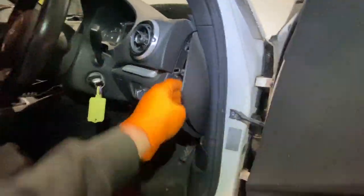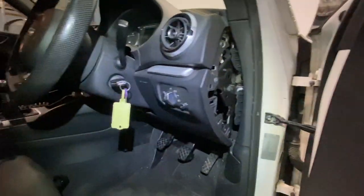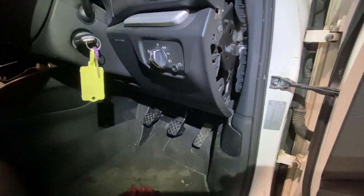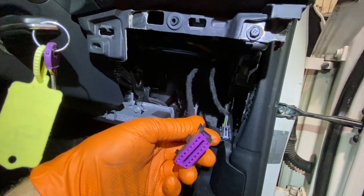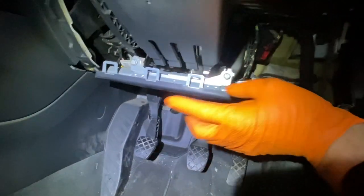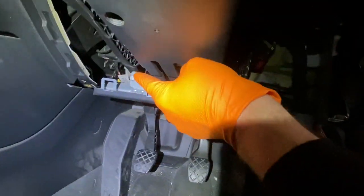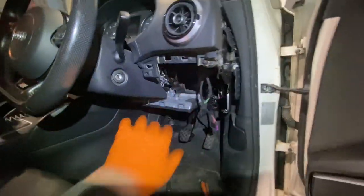Down and in here I'll pop off these bits of plastic. I've taken out air boxes and stuff to bleed the system. There are two size-8 bolts and a size-20 Torx here to get that piece out of the way so we can see what's happening at the master cylinder. Everything comes off easy. There's a little switch for the lights in here. I use the T20 Torx to pop out that trim piece — the little legs just pop out of place.